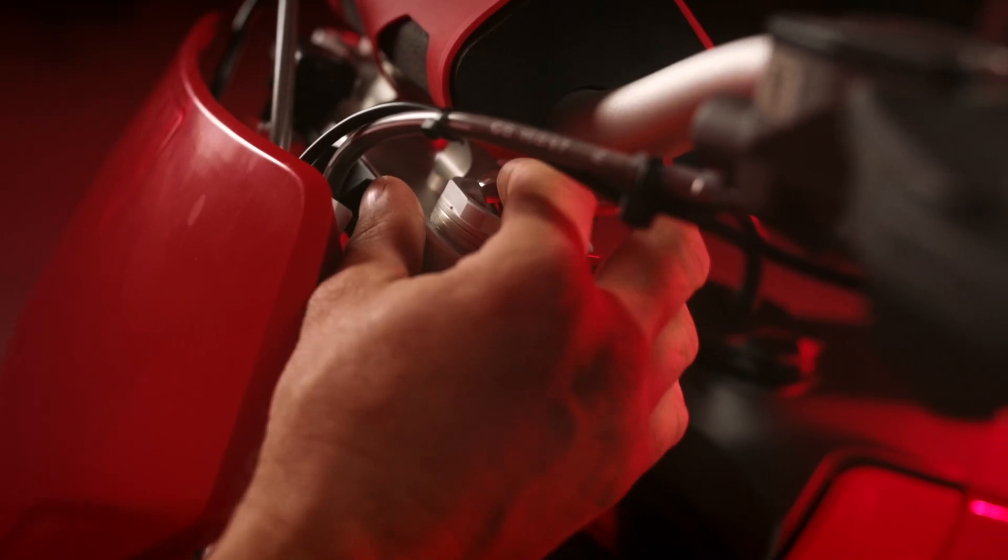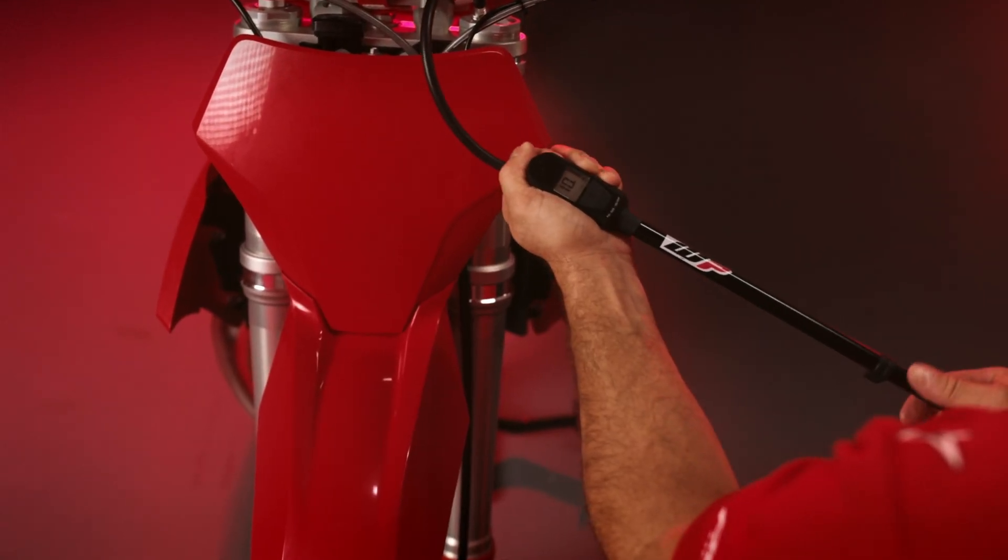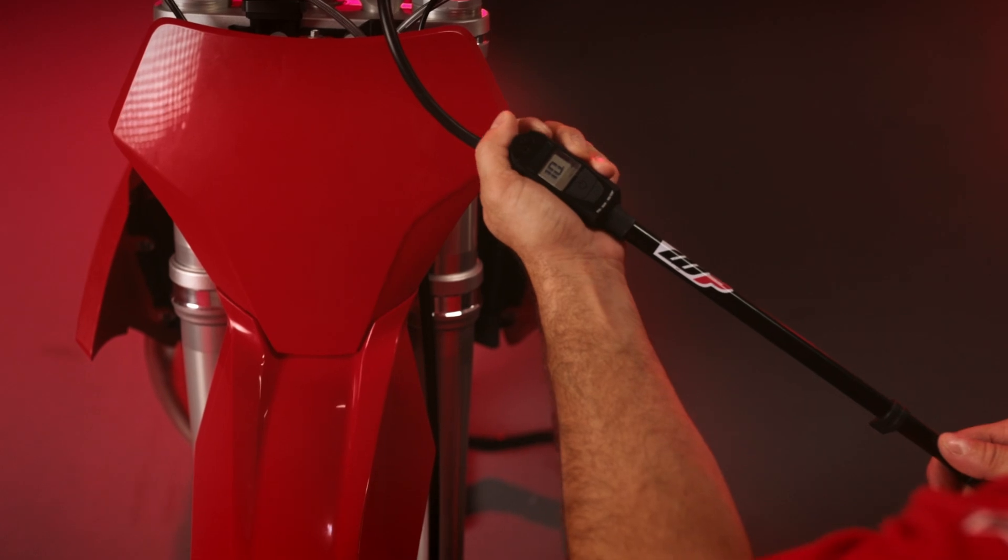However, it's important to note that in a closed cartridge air fork, we only find one spring leg and one damping leg that works as already explained with the closed cartridge system. In the spring leg, you will find an air spring cartridge housing with two air chambers, which creates the spring force needed to hold up your bike.